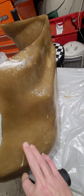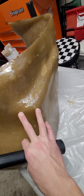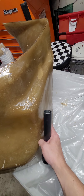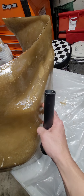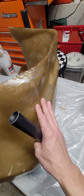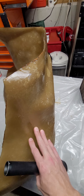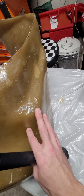I figured I'd show you this. So this is the back of my shelf. I did put one coat of resin only on the back of this — it's all smooth now. I mainly do that for a couple reasons. Number one, it's no longer rough on the hands, you can't cut yourself, you can't get stuck with fiberglass if there's a piece sticking out. And also it just kind of helps seal the back of it for any air leaks that might be coming through. Just a little reassurance — probably overkill, but I'd rather overkill the first time than have to go back and fix stuff.